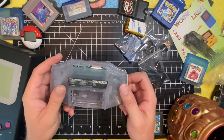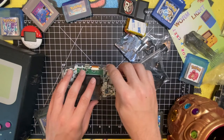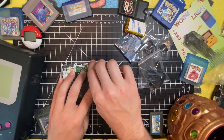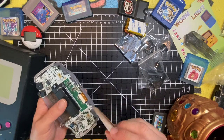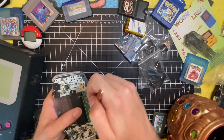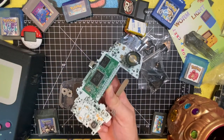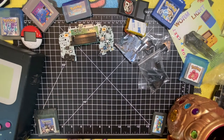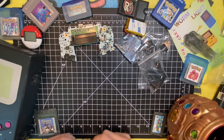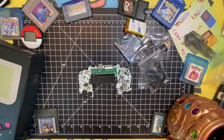This is already unscrewed and ready to go. We're just going to pop this back off, set it to the side. For this ribbon cable I like to use tweezers or a flathead screwdriver — with your nails you can sometimes hit it kind of weird. Just pop that out, be gentle. And that comes right out. Take the motherboard out. I'll probably end up either using the old parts in a future build or selling them on eBay to get some of my initial investment back.